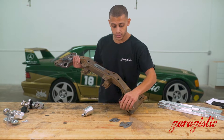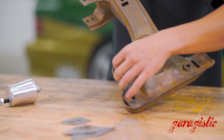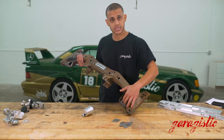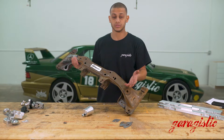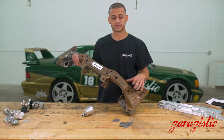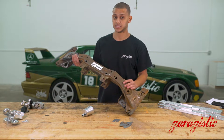The way these pieces go on is like this — from underneath. Some people have used these on the other side to raise their motor; it's really up to you. It's 11 gauge steel, so it is fairly thick, but it's not thick enough to throw off your drivetrain or anything like that. Sagging motor mounts will actually have the same symptom.